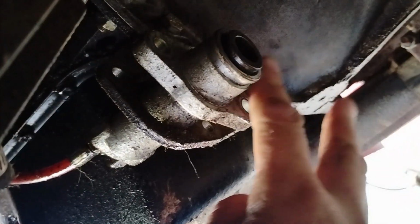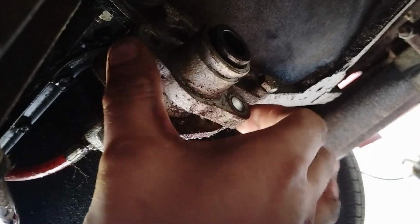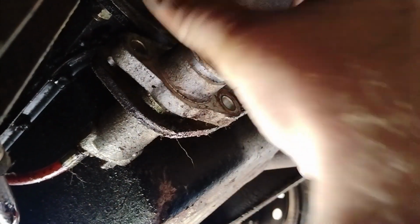We're taking these two bolts out here. There's bolts and nuts. There were washers in here. I think somebody shimmed this forward to give the clutch more throw because they were having a problem. Assume that's why there was a master or slave cylinder in the car when I got it. So I broke the line free when the bolts were still connected. That way I can just spin this out. And when we get it unthreaded, we're going to let all that fluid drain out of it too, because we're going to put fresh fluid in.